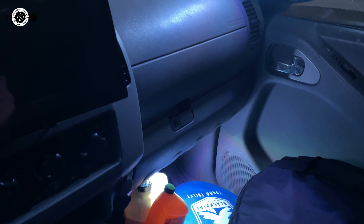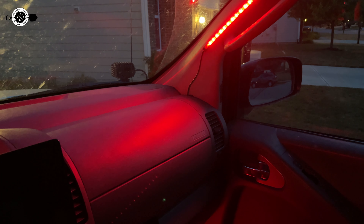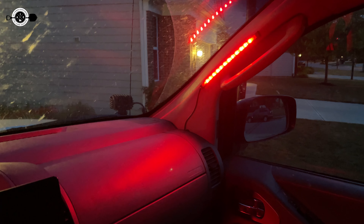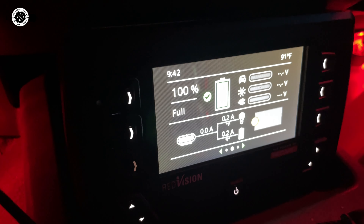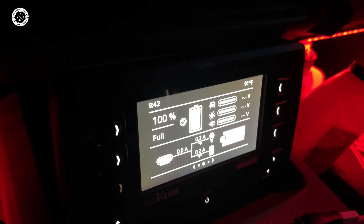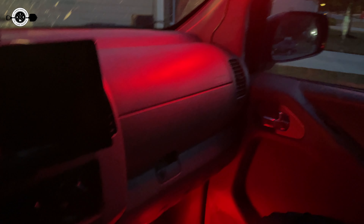I personally just like them red because it's not super bright or obnoxious. If you're at camp at night, they're really super low draw — they don't draw much power. I have these wired in constant 12-volt through my RedArc system so I can monitor how much power is being used. Right now you can see these lights are drawing 0.2 amps, which is very nice. Even at night, the draw is so low that it's not something to worry about.